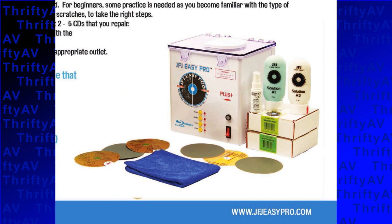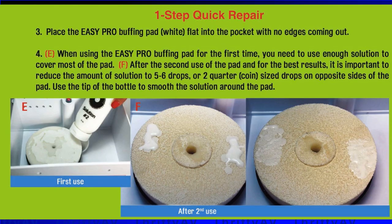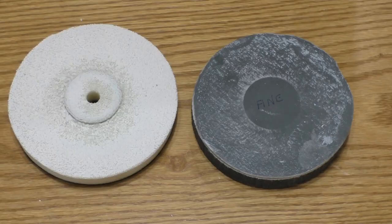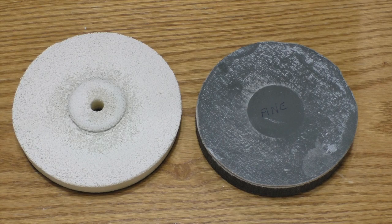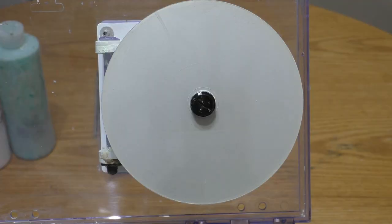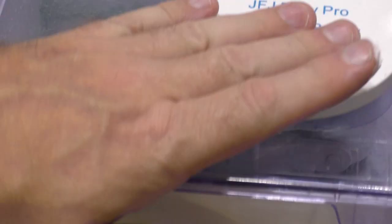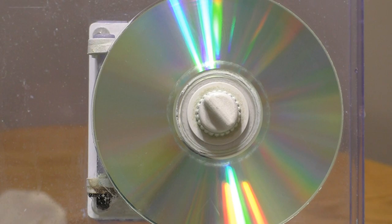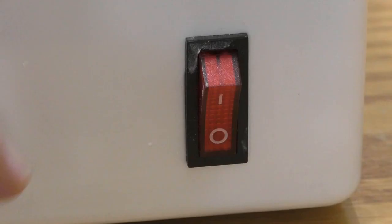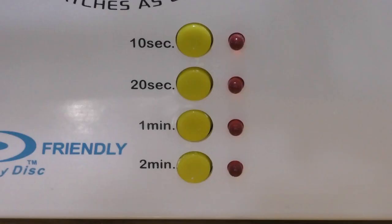The basic kit comes with two buffing pads, two sanding pads, three coarse sanding discs, three fine sanding discs, spray cleaner, and a cleaning cloth. You can use this machine as a one-step device for light scratches or as a multi-stage device for deep scratches and gouges. The machine works by spinning either a polishing pad or a sander on a pocketed pad holder with a Velcro base. Optical discs are attached to the spring-loaded arm attached to the lid. As the polishing pad turns, the optical disc turns with it and gets polished. A red button near the back of the lid prevents the motor from running when the lid is open. The unit has an on-off switch and four buttons on the front for timing options ranging from ten seconds to two minutes.